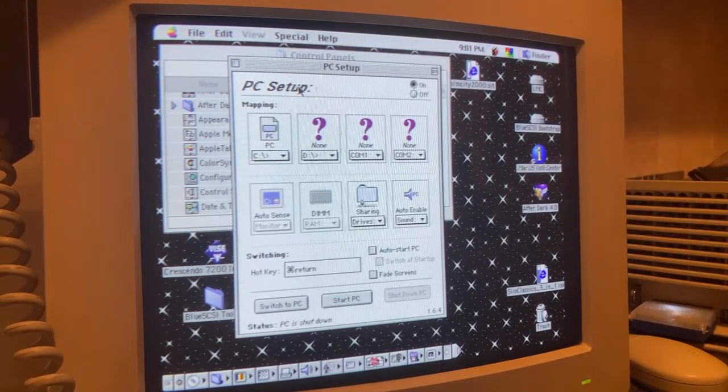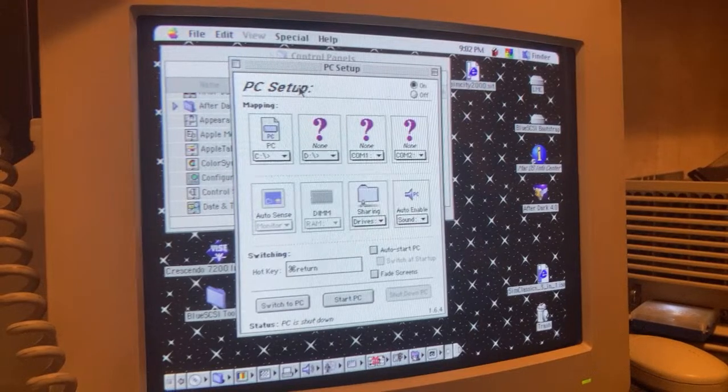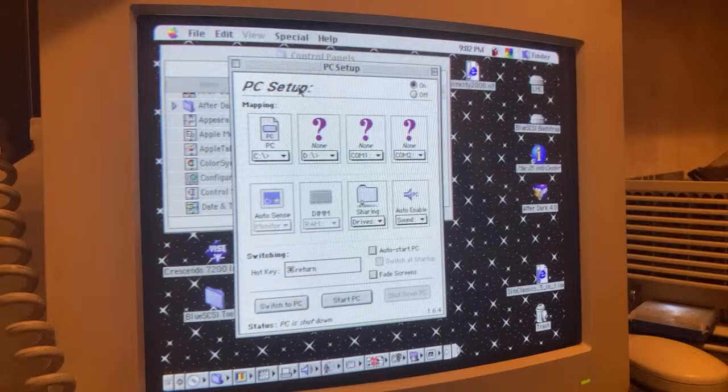But what I thought we could do is I've made disks for MS-DOS 6.22, and I also have a Windows 95 OSR 2.5 CD, which I think might give us some flak now that I think about it, because that release of Windows 95 was only available to OEMs. Once hard drives started coming with computers that were bigger than 2 gigabytes, if you can believe it or not, because FAT16 only supported volumes that were 2 gigabytes. And the biggest benefit that OSR 2 and 2.5 for Windows 95 was to use the FAT32 filing system to format drives up to 4 terabytes.